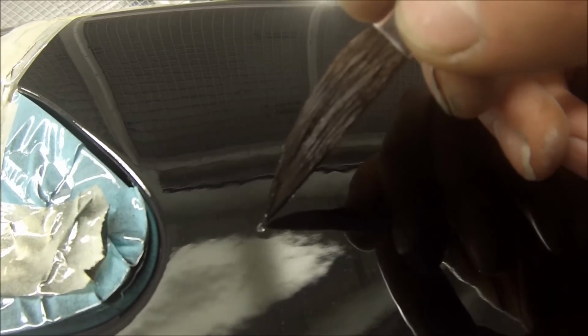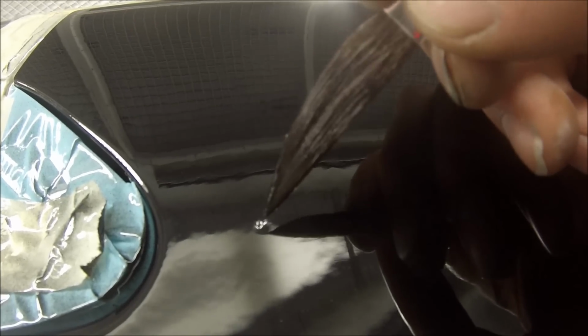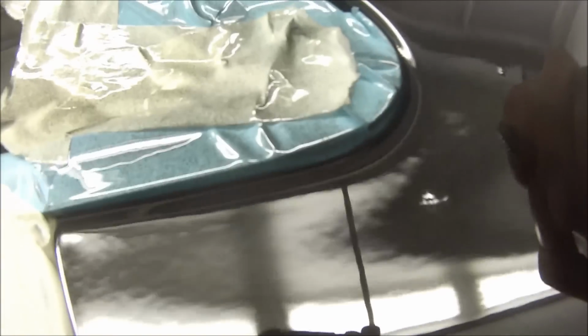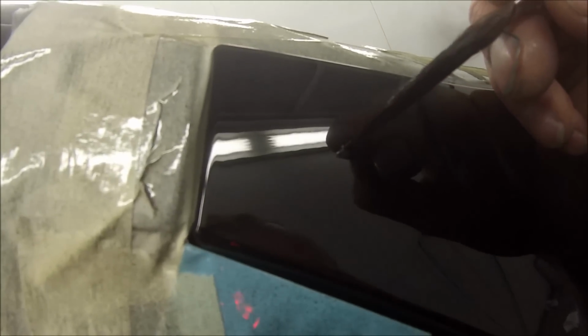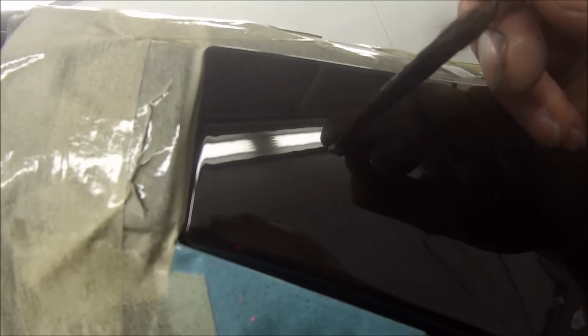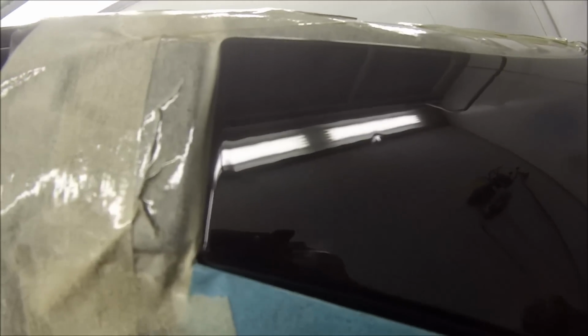So yeah, I missed out on the polishing stage, but all we did, if it's been left overnight, you could use the tungsten block and shave the high spots down, and then use your wet rubbing block and I'll probably even start off with some 1200. You wouldn't want to go much coarser than that. So 1200, and then you go down through your grades down to 2000, and then you could also use the 3000 grit over the top of your 2000 just to enable it to polish up a bit quicker. So just taking my time and making sure those touch-ups are really nice.